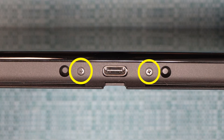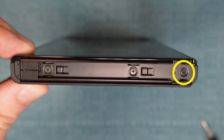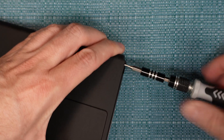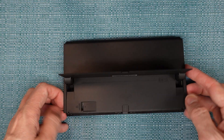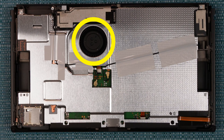Remove these two on the bottom, and this one at the top, and on each side remove the one that's close to the edge. Be warned, that screw is tight because it goes through metal, and therefore it's more susceptible to getting stripped. Remove the back panel — you kind of have to work the edges until more and more of it starts to separate. If you only wish to clean the fan, you have a good amount of access to do it from this point — just blow on it.